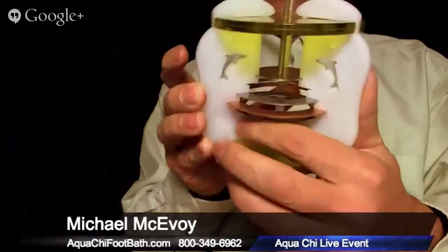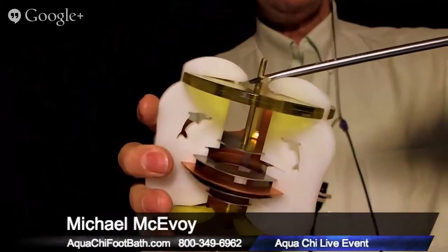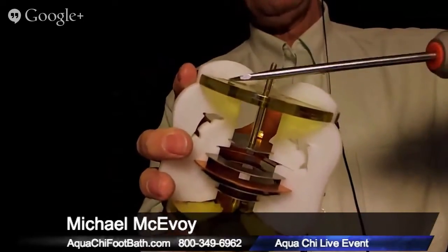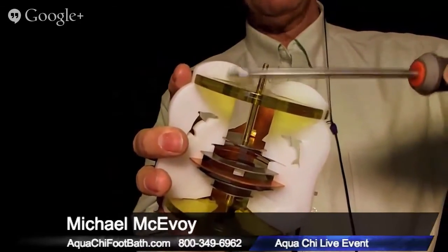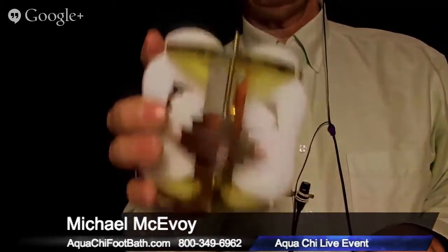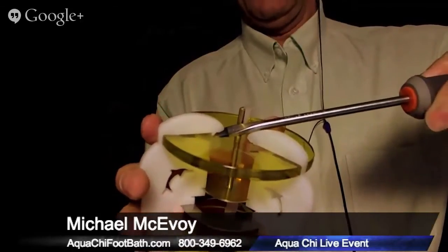The shorter leg with no longer slits is the one we're going to remove. To do that, put a flathead screwdriver into the indentation on the top of the module and give it a slight turn — I say slight because you don't want to stress the plastic so much that you break it. The best thing to do before you start is to soak the module in very hot tap water for 10 minutes. That gives you more pliability in the plastic and reduces the risk of breaking it.